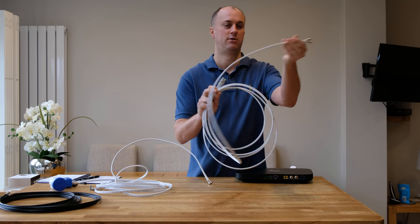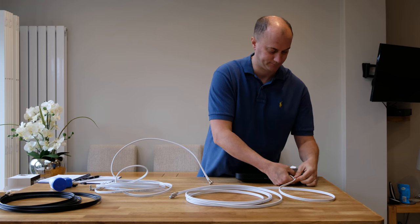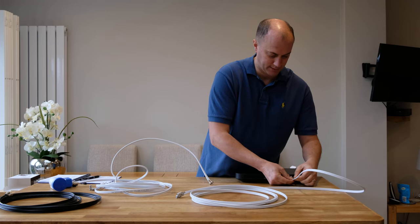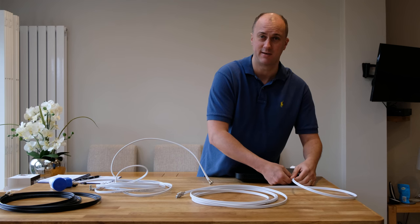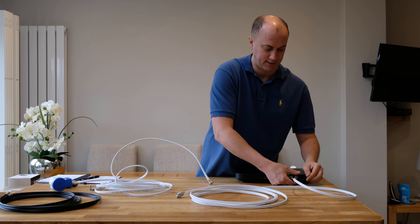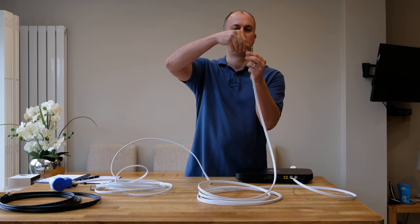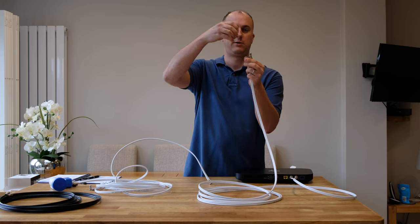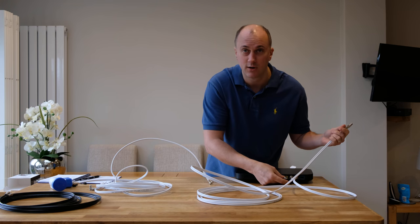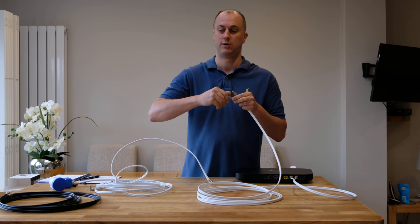So I'm going to plug in this new cable here, same as the one I've just unplugged on the back. Attach that there — just make sure you push it in straight so you're not bending the pins, giving you a nice secure connection. You've got F connectors here that connect very quickly and easily on the back. Then on the other end of the cable we've got joining couplers. We use these so you can extend the existing cable you've already got — it replicates what's on the back of the box because it's the same connector. So we leave those two on there because you've got two connections.